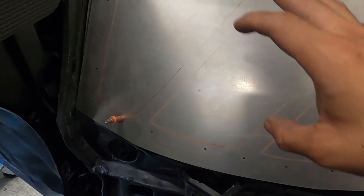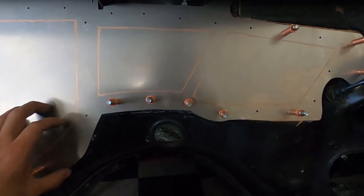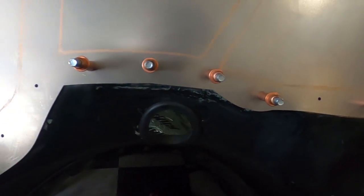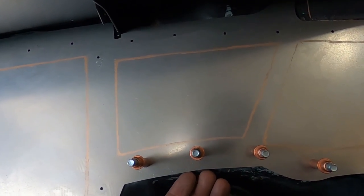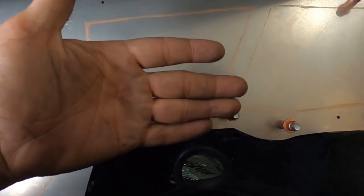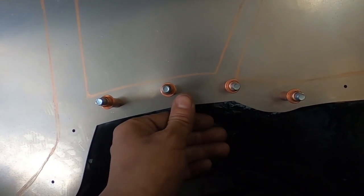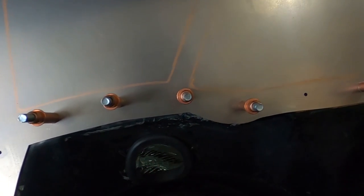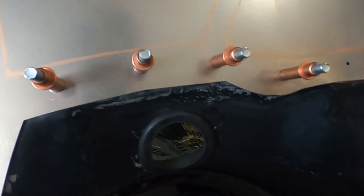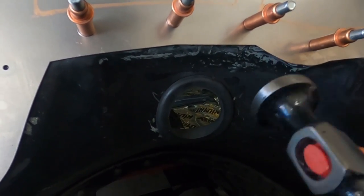You're going to have a few small spots that aren't perfect since every firewall can be a little different, but for the most part it should have a pretty good fit. The reworked area is definitely the hardest part — there's kind of a waterfall effect on this firewall. But you can get it pretty tight. Once it's zipped in with the clecos, use your body hammer to work the edge down flush.